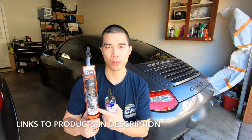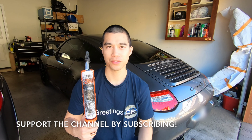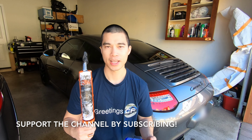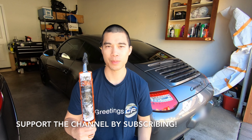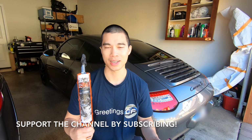I really like the 3M window weld because it does give you an improvement in your throttle response and the engine just feels a bit more planted. When I take it to a track, we'll see if I actually feel a difference, but my guess is I probably will, just because engine mounts do a big part of keeping the engine in place, and that's a really important part for handling, braking, essentially everything. So if you are going to fill your engine mounts, definitely use something like the window weld or something stiffer.